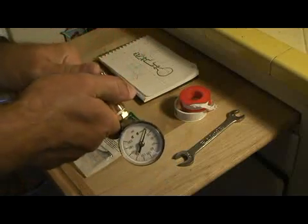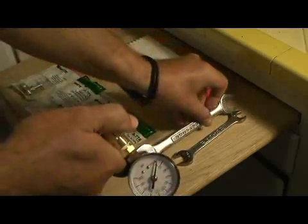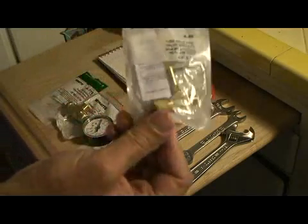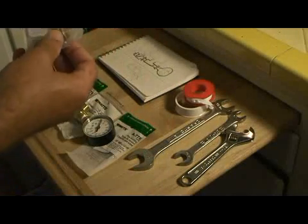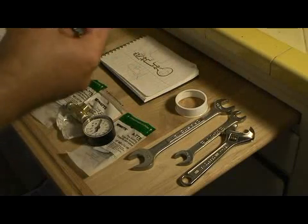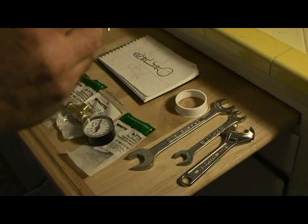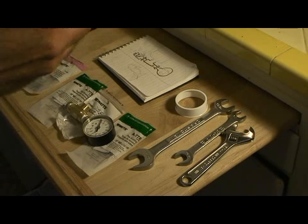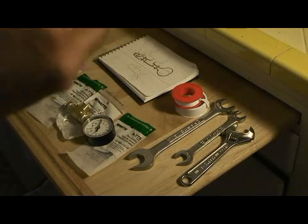These are all food grade tools. This is just for testing — we're not going to be drinking anything out of this. And then the last part is the valve. We can close the valve off and look at the maximum pressure that the portafilter is putting out. And then we should be able to just slightly crack it a little bit, release some pressure, and hopefully simulate an operational portafilter.